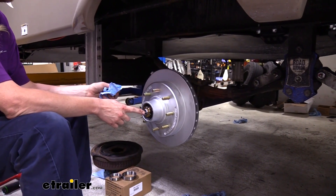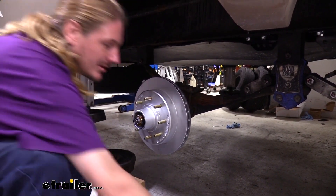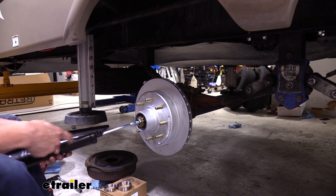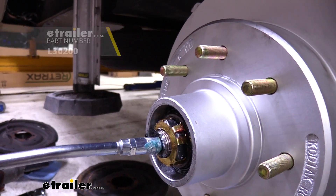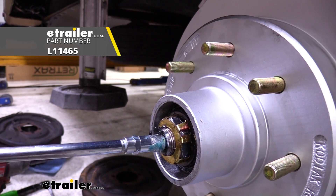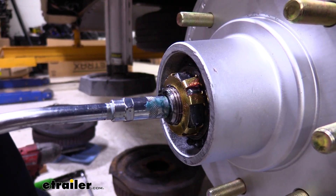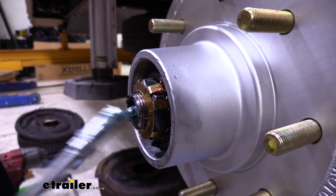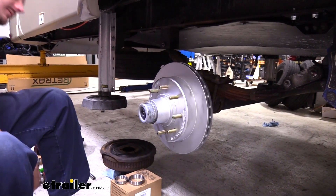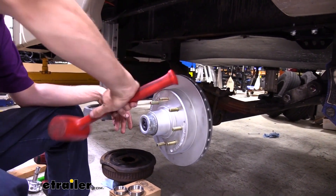At this point we're going to use the grease fitting here to finish packing the rest of the cavity inside our rotor assembly. We're going to take our grease gun and fill it up until we start to see some grease push back out of our bearings. If you need a grease gun you can get one here at eTrailer.com. Once you start to see it push grease out — just like it is here — that is plenty of grease. We are fully packed. We can take our cap, put it back over, and tap it back on. I did wipe the grease out from inside the cap to get rid of all that old red grease. Just lightly tap it on until it's fully seated all the way around.